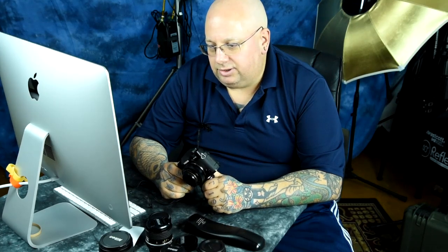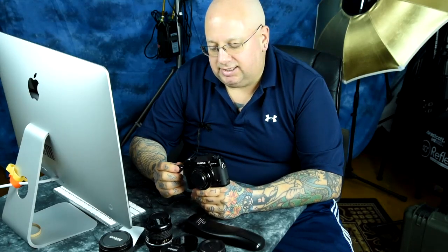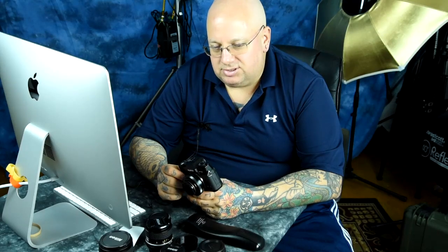Clean it and recheck. Typically if you've got a dirty sensor you'll probably have to use two wet swabs. If you're a Sony owner, you can't do it at all because Sony will void your warranty — they've got exposed contacts for in-body image stabilization and they don't want you touching your sensor.